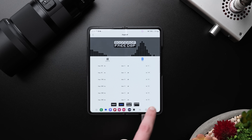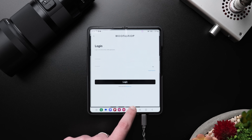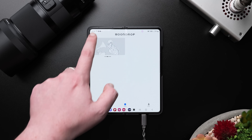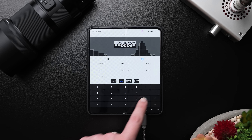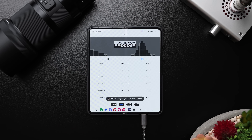Once you are in, you're greeted with a display where I discovered some very significant limitations to the EQ that are not mentioned on the product page. Firstly, there are only peak filters — no shelving filters — so you can't add a bass shelf or a treble shelf. You have to do everything with peak filters, although there are a decent number of bands available, nine in total. Secondly, you can only configure EQ bands between 40 Hz and 10 kHz, which is a bit of an odd limitation.